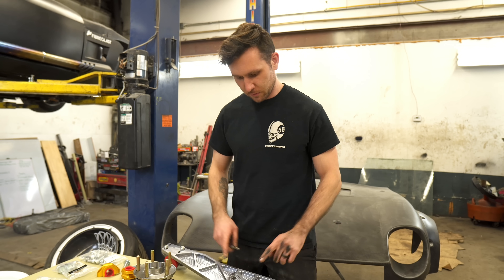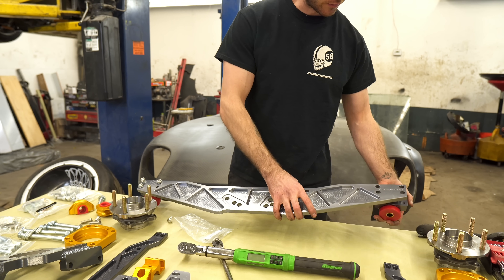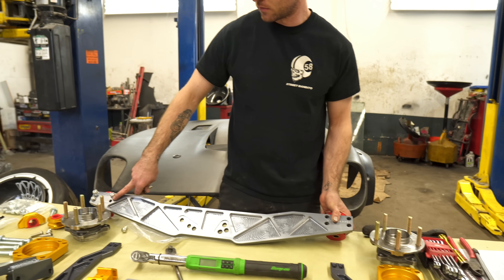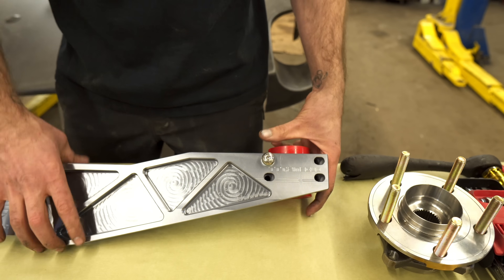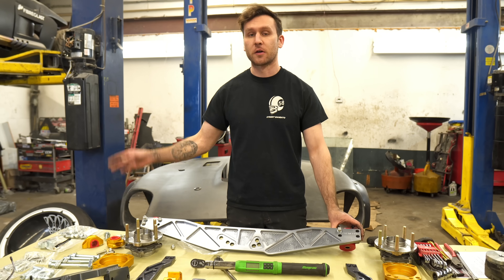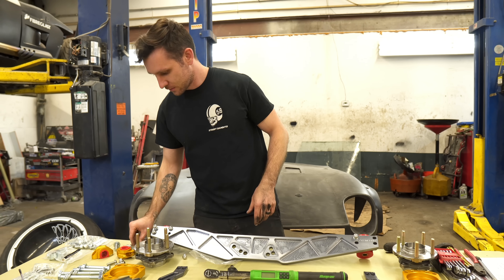One other thing I want to mention real quick with the mustache bar — this is the same mustache bar they run for the R200 short nose and R230. They have all the mounts and they're all labeled on here. So even if you don't have the Ford kit and you have the R200 kit, their newer version of this has slots on the ends on one side only. See how these are just circular and these are oblonged over here — that gives you a little bit of play left and right on where to mount this to make sure the diff is perfectly centered. Because these cars were built 50 years ago and they're not going to be exactly factory standard.